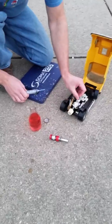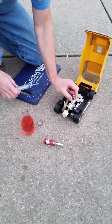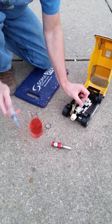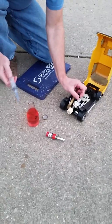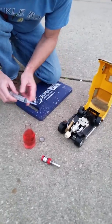Here are the steps in getting this thing started. First thing you do is you want to make sure that the needle valve is completely closed so we don't flood the engine. We're going to gas it up. The fuel is a special mix - 20% castor oil. We're going to close this needle valve all the way down until it's closed. You don't want to tighten it too tight, just thumb tight like that.